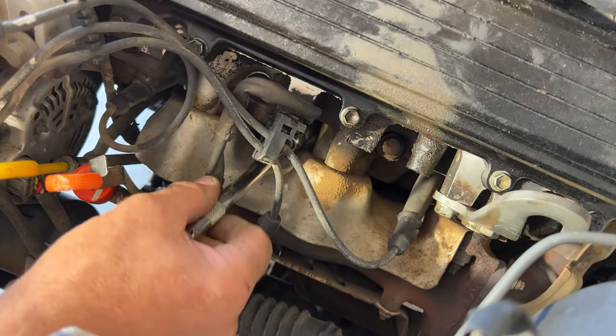Next, we'll go ahead and remove the rotor. And you got two Phillips screws holding that in. So go ahead and pull those out of there. And that one wasn't tight at all for some reason. Get those loose. This should just pop right off of here. So just like that. And we will need to reuse these two Phillips screws there.